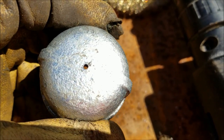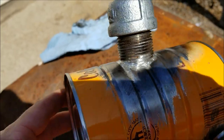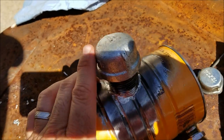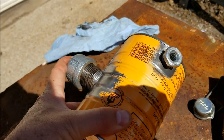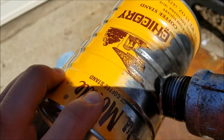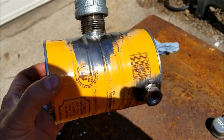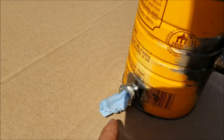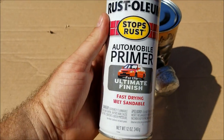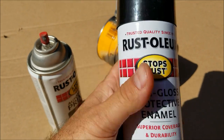I finished cleaning up the solder and I decided I'm going to paint it black — I think it'll match the bike well. I did a leak test by putting my mouth on it and putting my finger over the hole, and it didn't lose any air, so the solders are good. I'll clean it off before painting to make sure all the oil is off, then put a couple coats of spray paint on there.